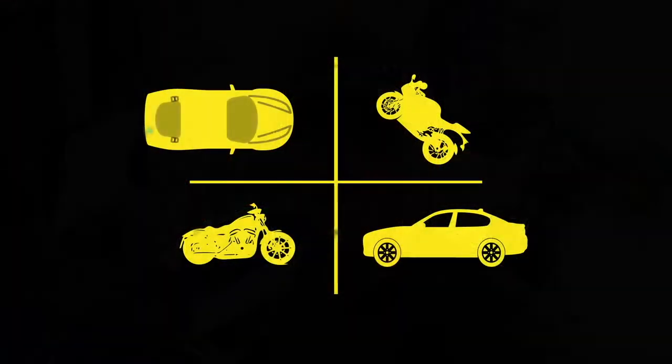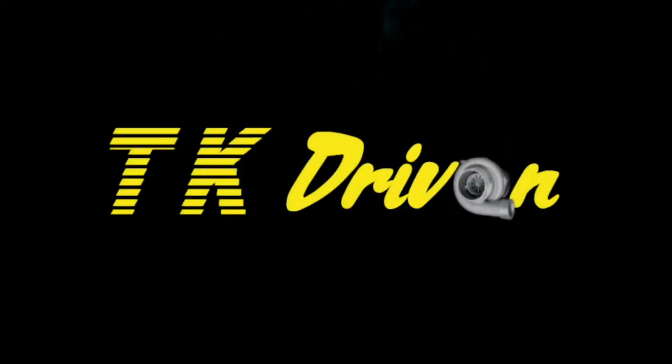What's up everybody, today on TK Driven we're going to change the front sprocket on my 2010 Iron 883. I've got some really exciting news — next week my dad and I are going on a week-long motorcycle trip. We're going to be in Gatlinburg and take the Blue Ridge Parkway to somewhere up in Pennsylvania. We're just going to wing it. But first I want to address an issue on my Iron 883 — at interstate speeds like 70-75, it's a little buzzy. I wish it had a sixth gear, so I've ordered a sprocket with more teeth.